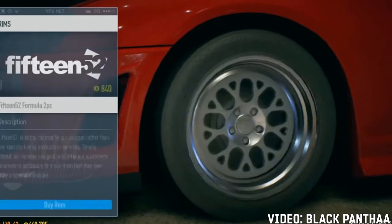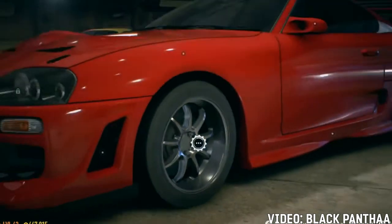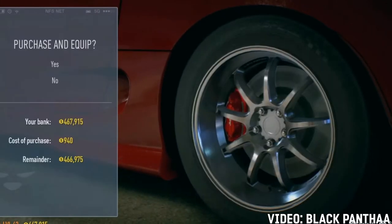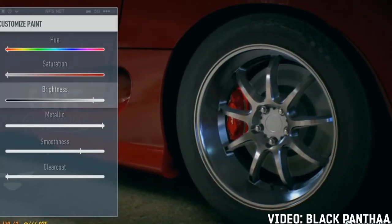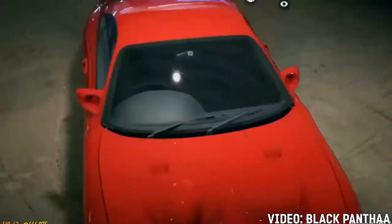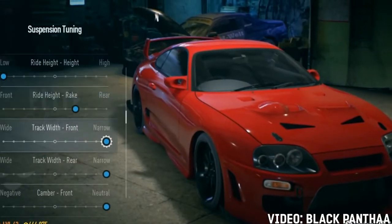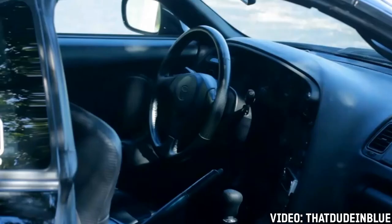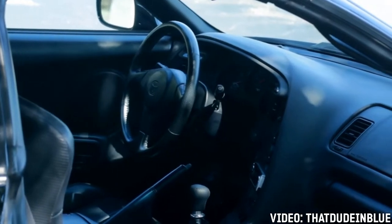Test drive. Have a friend follow behind you in another vehicle while you go for a test drive. Have your friend watch for smoke while you drive. Put the car in second gear, let the RPM drop to about 1500 RPM, then punch the throttle and stay on it until red line, and finally let off the throttle. Your friend should be watching for gray and blue smoke similar to the initial inspection.